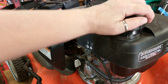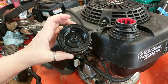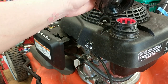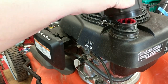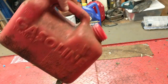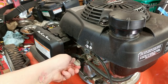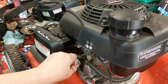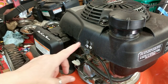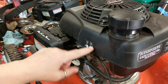The next thing I'm going to take a look at is the gasoline and see if it smells bad or looks bad. I can sort of smell it from here. This time of year, people often put good gas in a bad gas can — it's easy to do. It might have some water in it, but it doesn't smell good and we'll be replacing it anyway. The other thing about Hondas is they actually have a fuel tap on them, which is great — you should use it.